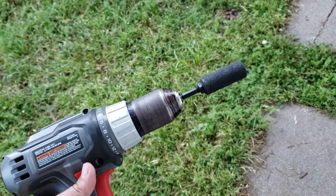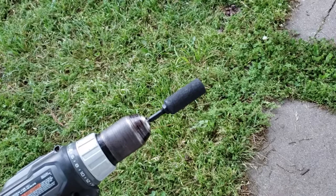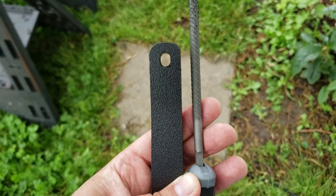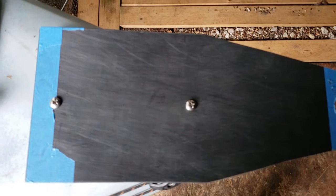The BBP fits down into the VAG sleeve pretty nicely — it's a pretty smooth fit. I'm trying to mount my base plate. I did notice one of the holes I drilled is going to need to be elongated just a little bit. So I've got a rat tail file here to ease those holes open until they accept the screw. All it took was just a quick little touch with that file and then the quarter-20 screws went right down into the threaded inserts that are molded into the kayak where the rear handle normally mounts — beautifully.